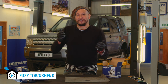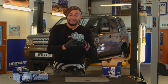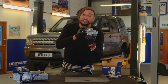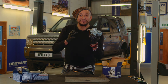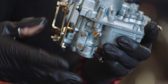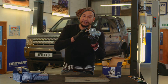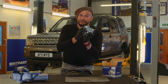Loads of people love a circus, and in every great circus there ought to be a fantastic balancing act. In your car's engine bay, there is another fantastic balancing act — the balance between air and fuel. The carburettor performs that great balancing act. If you have too much air and not enough fuel, the combustion in the combustion chamber will be hot — hot enough to melt aluminium pistons. Conversely, if there is too little air and too much fuel, you will get an unclean burn with a lot of carbon build-up. The internals of the combustion chamber get dirty, the valves get dirty, everything gets covered with a layer of soot which hardens up and chokes your vehicle, effectively stopping it from breathing properly. The carburettor's balance is vital to your engine's health.